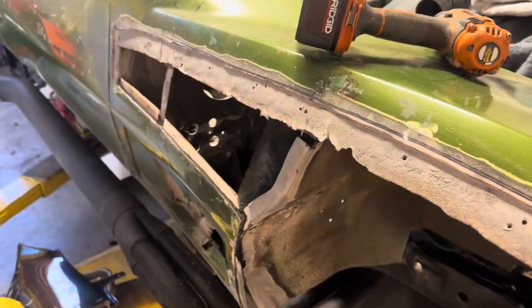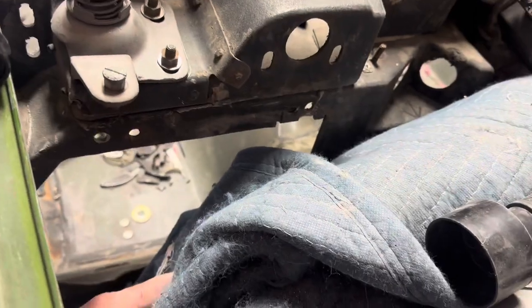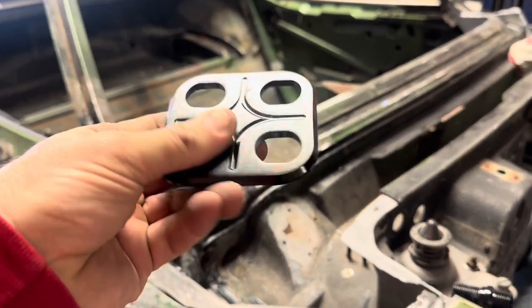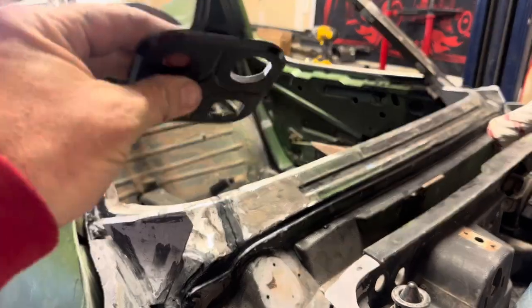Another small project — just trying to take care of things before I glue these fenders on, checking them off the list. So I decided to delete the big access hole for the factory air and I'm going to put in a small bulkhead for heater hoses. Pretty common in these builds, but let me show you what it looks like finished. I think it's a nice little addition.